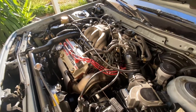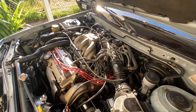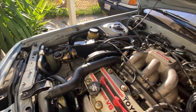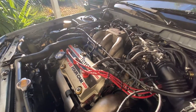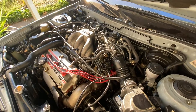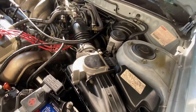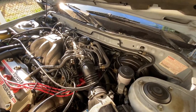I also swapped the spark plug tube gaskets. I only did the back ones — I was going to do the front one but since it's not leaking or anything, I decided not to. If I ever end up having to do it, it's way easier because the only thing I have to remove is that tube right there and then everything else just comes off. It's a pretty easy job overall — it's just time consuming because of all the stuff on top: the manifold, the cold air intake, throttle body — it's just a lot of bolts, tubes, and wires.